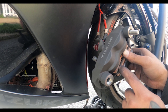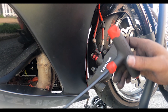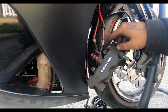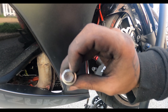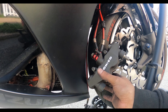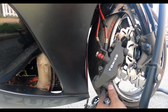You're going to need a 5mm allen key and a 12mm socket. The 12mm is for the bolt up here and there's a bolt down there too. It's an easy job — just tedious. You take these two pins out and then the brake pads fall out.